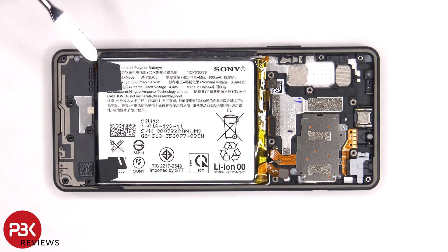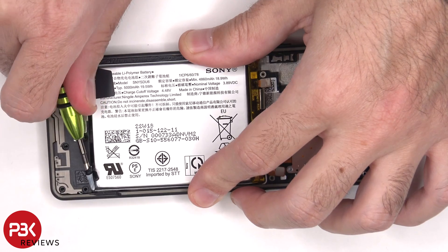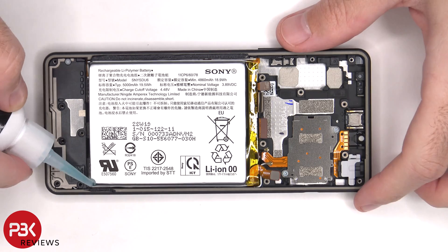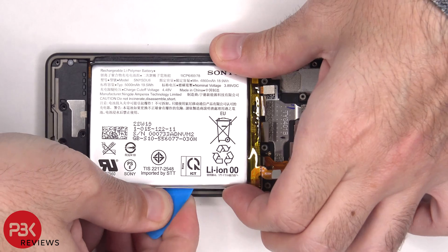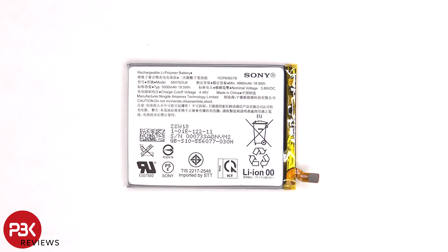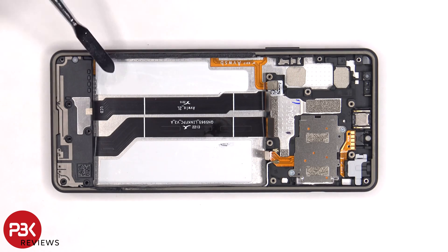When it comes to removing the battery there are adhesive pull tabs on the bottom to help you pry it off. About 90% of the time I hate these pull tabs since they always tend to tear. So we're going to have to use some isopropyl alcohol and apply some to the edges of the battery, letting it sit for about 30 seconds to a minute so it eats away at the adhesive underneath making it easier to pry off. Here's a better look at the 5000mAh lithium polymer battery. The adhesive underneath the battery is really thick and strong, so without the isopropyl alcohol just trying to use the pull tab on its own will almost always result in tearing it, so it's pretty useless.